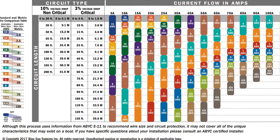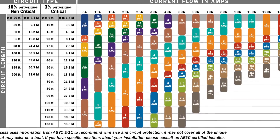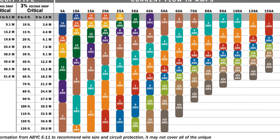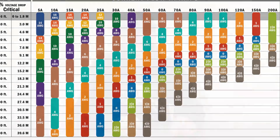There are charts that dictate what size wires to use for a given amperage and distance. When we get to 200 amps or more, 2-0 wire is a minimum regardless of distance. The frame-rail battery is connected with 1-0 wire from the factory, and the whole battery bank connects to the starter with 2-0 wire. The wire run distance from the frame-rail battery to the starter is over 15 feet total. So 2-0 wire is the absolute bare minimum for the kind of amperage we can see when the starter is trying to fire up a cold 7.3, and it's probably undersized.